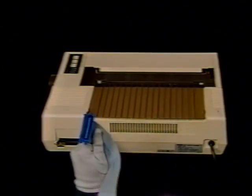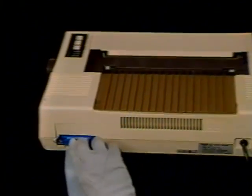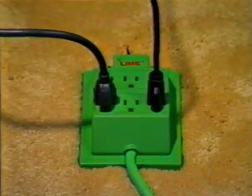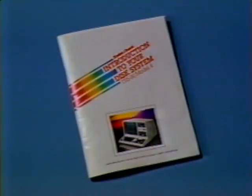Take the other side of your printer connector cord, which sort of looks like a big letter D, and attach it in the same way to the printer. Then plug both devices into a three-pronged wall outlet or a surge box, and you're ready to go. You'll notice in the center of the machine there's another connection — it's for a telephone modem, a device used for sending information to and from your computer over telephone lines. You should rerun this segment of CompuTutor one more time to make sure, or read over pages four through eight of your Radio Shack owner's manual regarding assembly.